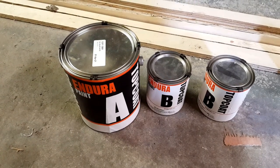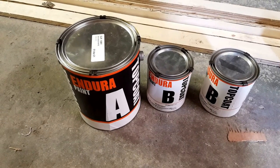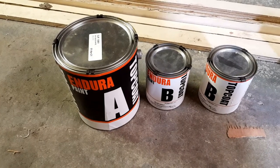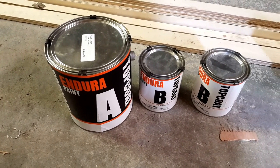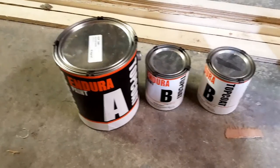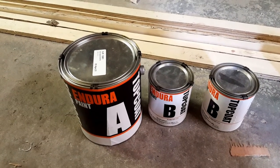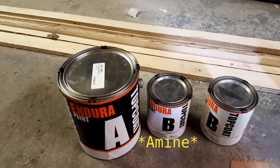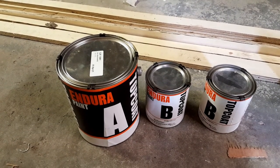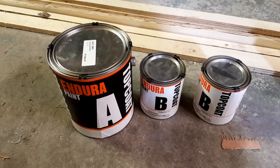So now we got the epoxy on the trailer, has been cured for a few days. So now it's going to be painting. I sanded the whole trailer with a little SOS scrubby pad, just to get rid of, I can't recall the name of it, the byproduct that comes off of epoxy. It's like a waxy substance during the curing process. But anyways, used a little scrub pad just to get rid of that. Cleaned it all down with microfiber cloths and some water.